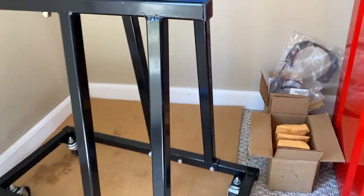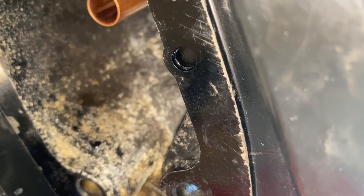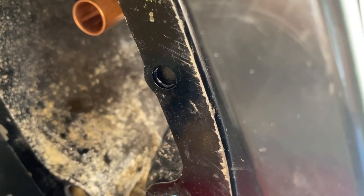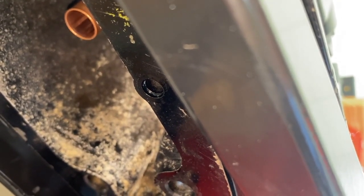I rotated the stand to show you the oil feed line or hole. Underneath here there are a lot of holes for your threaded studs on the lower unit to feed through, as well as the nuts that secure the upper to the lower. A common cause that someone can run into is sealing the wrong hole — if you try to seal a hole that a threaded stud goes through, you will never be able to pressure test the upper unit successfully. Pinpoint your oil feed line or port — in our case it is right there. You want to use rubber or something that creates an airtight seal; we used rubber and a c-clamp. If you hear hissing at that point, reposition your rubber pieces and tighten the c-clamp to ensure no air leaks out of that hole.